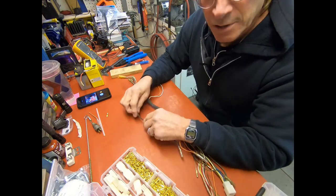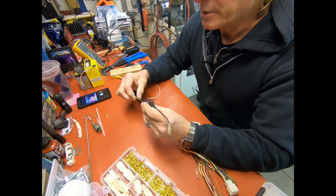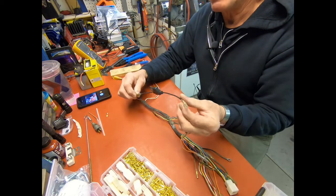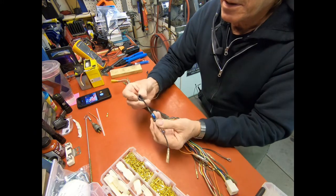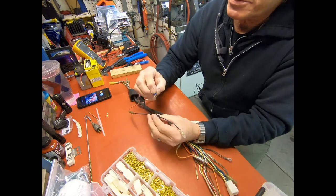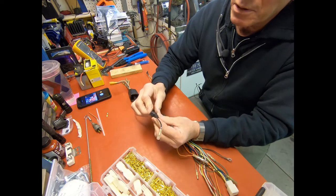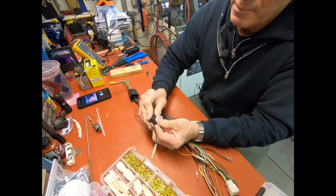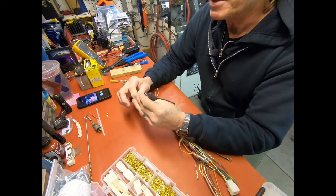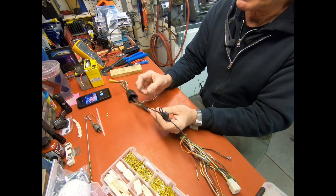Another thing, and this is just my personal thing, is I haven't changed anything as far as the hookup of the wires here, but I'm able to use a mini fuse. It's new technology. It's got the little prongs. These are a lot better than the glass tubes. They're not original, but they're a lot better, and they're out of the weather. And this little piece here is about $3.50, and this is how the glass fuse hooks in right here, so none of that has changed.